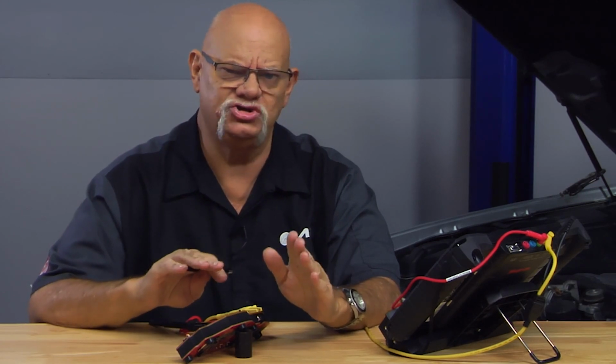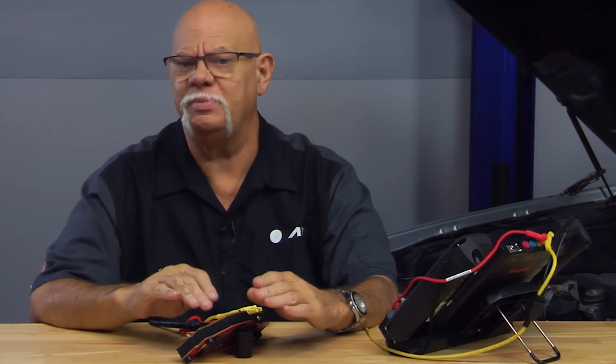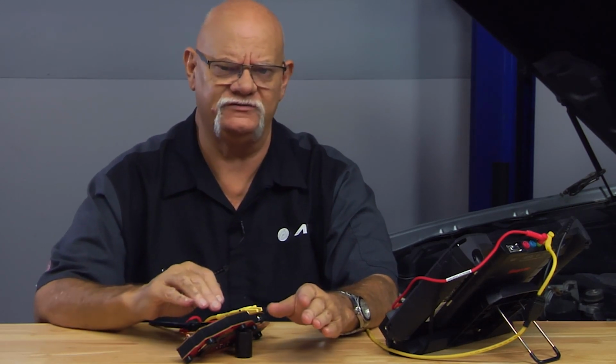It's not a bad idea to get yourself tuned to and accustomed to looking at crank and camshaft sensor at the same time. The other benefit of it is if you have a known good pattern on the particular vehicle you're working on. For example, if you know the relationship where the cam's leading and trailing edges fall in relationship to the crank sensor, as the computer, or possibly you with a bidirectional test on your scan tool, command to advance the timing, the camshaft sensor should shift to the left. If you choose to retard the timing, it should shift to the right.